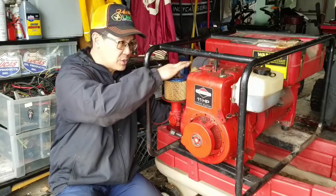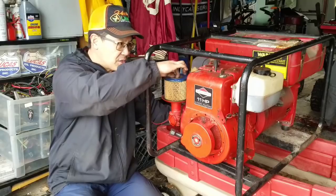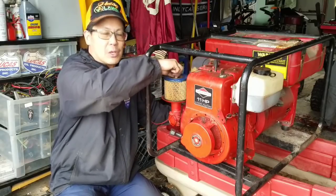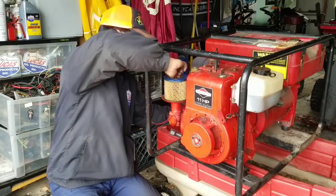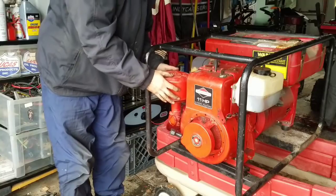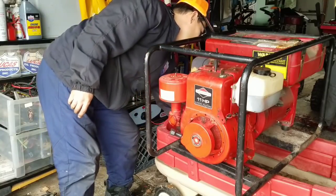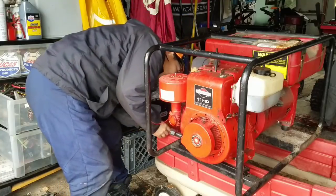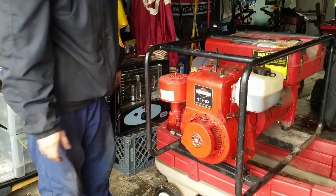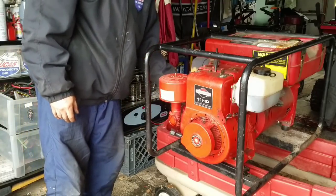And then we saw that the ignition switch was messed up, which was giving us problems starting. Once I figured out the right ignition switch and made this fit in here, grounded it correctly and wired it fine, it's all good. So I'm going to need to look into the schematics of this and the model number and figure out how the throttle really works. What's the original throttle for this? Because you almost have to hold it for it to be dialed just right.